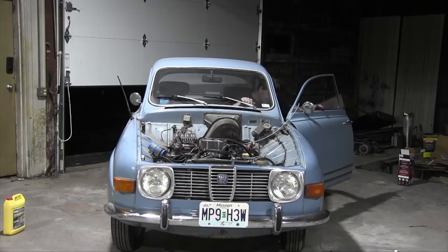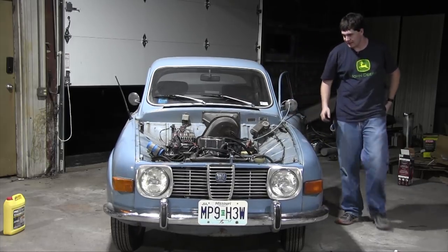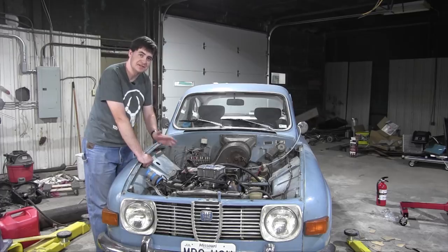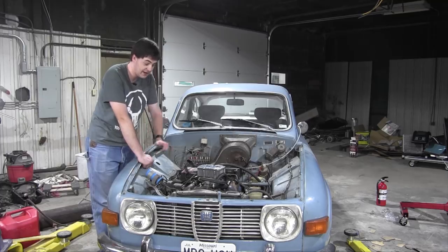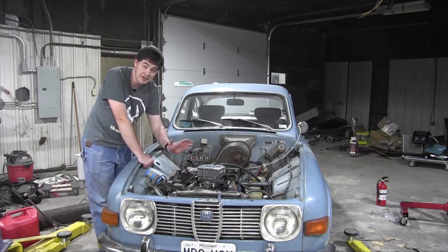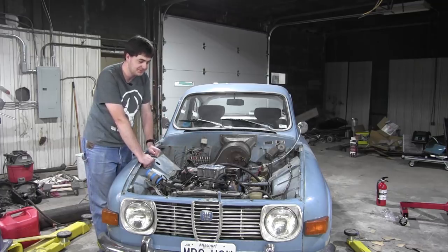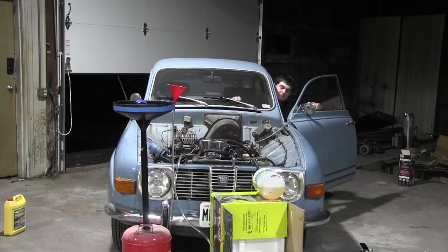I feel like there's still a vacuum leak somewhere, or the other possibility is I don't have enough fuel to it. So here's the situation. I have now fixed all the vacuum leaks as far as I'm aware. I even plugged the vacuum lines on the carburetor base plate, and there appear to be no vacuum leaks whatsoever. I also checked the fuel delivery system, and the fuel pumps work so well that they pumped a bunch of gas onto the ground without me realizing it. So that works fine. But despite all of this, the carburetor will not run unless it is fully choked.